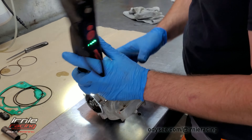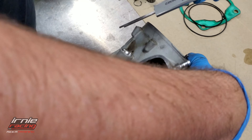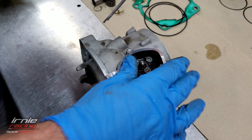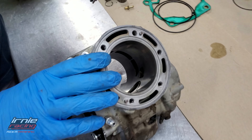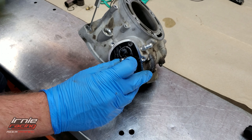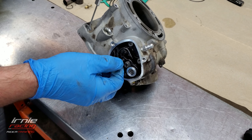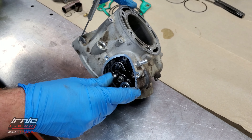So basically I'm just checking the height of your power valve flap, because that's actually adjustable as well. It'll stop there - that will tell you how far to go down and stop. So that's even adjustable. When you do your adjustment, you're adjusting on the side of the clutch cover, and that causes this cam gear to move up and down. That's it.